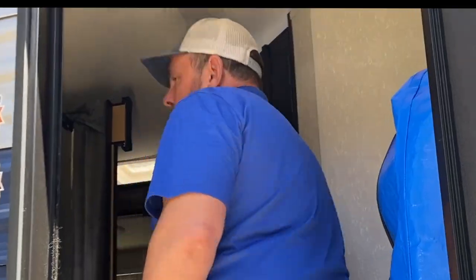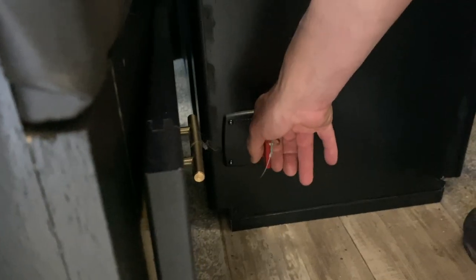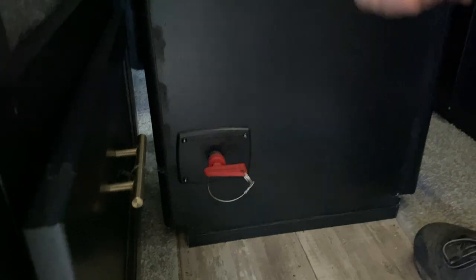Let's put the slides out. Always want to make sure cabinet doors, drawers, everything's closed up, nothing's in the way. We don't want to break anything when we're opening the slides. At this point, you're going to want to turn your batteries on before you attempt to run the slides in and out. Does it look like anything's in the way? We're going to hit the button and see what we got.